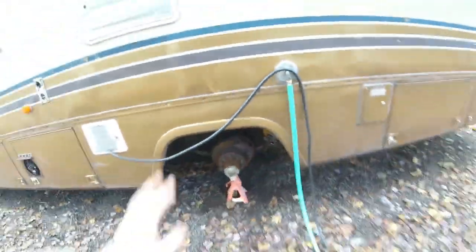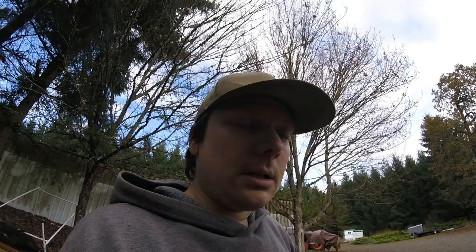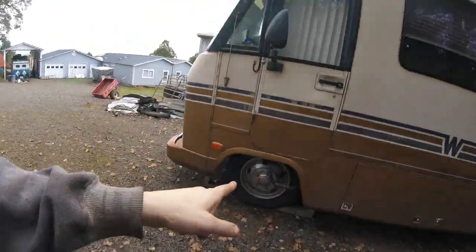With the wheels off, I'm going to slip that in while I'm working on the sumo spring install. After that's all done, I'll get the front jacked up, take a look at the calipers, spin the tires, and see what they feel like. If one's dragging more than the other it would be the passenger side since it's pulling to the right. I'll see if there's anything I can do about that and check the bearings — probably repack the grease anyway since it's about time.